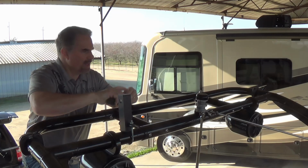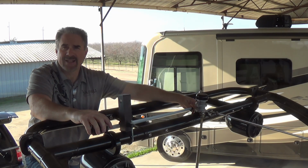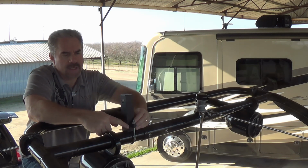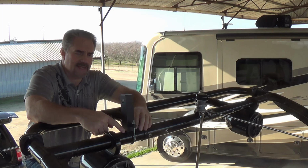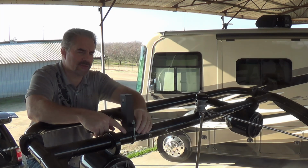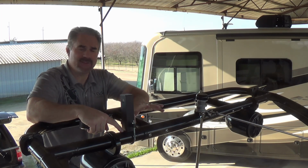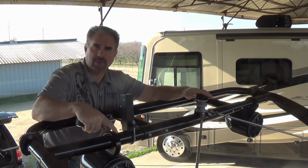Now go ahead and take your tape measure from the crossbar, measure out 18 inches, and that should be exactly where your U-bolt is. Also, make sure that the tie rod is centered inside the riser. If your tie rod is centered, then it ensures that your riser is sitting squarely on top of the tower. Okay, now that we've done this side, we're going to repeat the exact same step on the other side of the crossbar with the ski pylon.